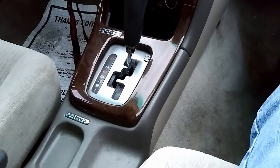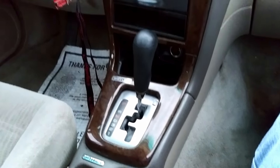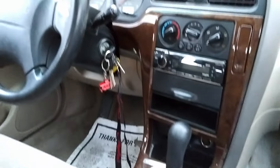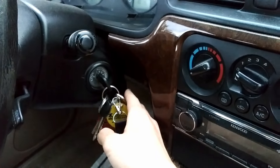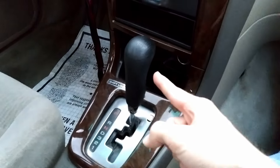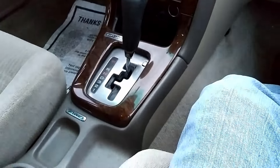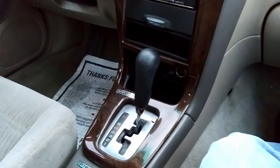One of the problems with the shifter being damaged like this is that, while it still functions, sometimes it won't let you take the keys out, even when it's in park. Unless you're in park or neutral, Subarus — at least from 2001 — won't let you take the key out if you're in any gear that wasn't park or neutral. I have the key on and keys in the car. I'm going to turn it off, but you see it doesn't go to the zero position and I can't take my key out — unless I push the shifter. It just fully clicked over, and now I can take my key out. Minor thing, and if you know about it you can live with it, but it's still a minor annoyance, especially when I'm having to get out in a hurry or something.